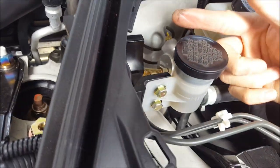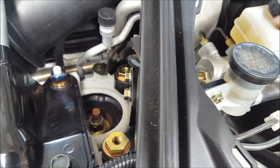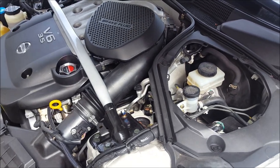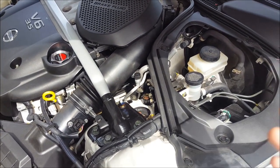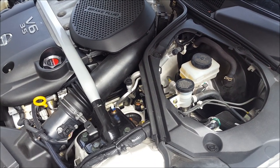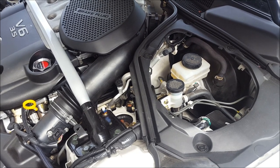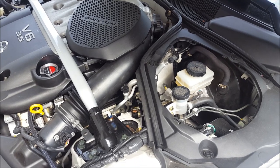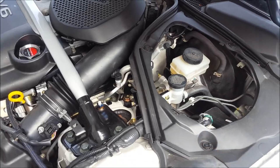The load is coming off the brake booster from your foot all the way in and down, and this corrects that whole issue. What I noticed immediately was a much better brake feel. Now it's not perfect — it doesn't make it super tight. It's dependent on your calipers and the actual pedal itself, but right off the bat my brake application just felt a lot better. For a lot of you guys that do autocross or any kind of racing, pedal feel is extremely important. Doing this mod alone — it's under $200 to buy this piece — it's worth doing.